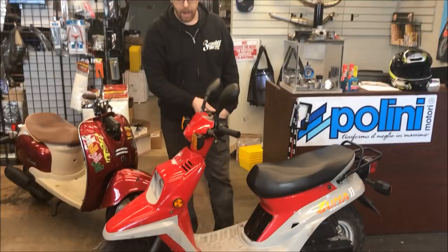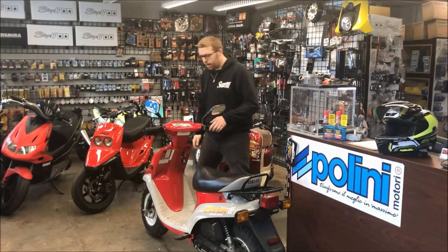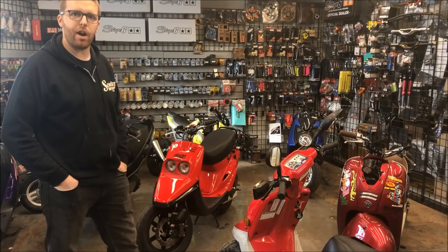The biggest thing you want to look for on a wheelie bike is a pretty short wheelbase. Pre-bug's really good because it's got the vertical motor, obviously, so the motor is tucked pretty far forward. The other thing about the pre-bugs, the earlier models with the drum brakes, is that they're quite a bit lighter in the front, so it's going to make doing wheelies on a stock pre-bug a lot easier to get it to pop up. The disc brake stuff probably adds, what would you say, maybe 5 pounds to the front or so. The wheels are probably heavier, yeah, the caliper and all.